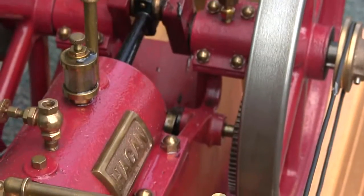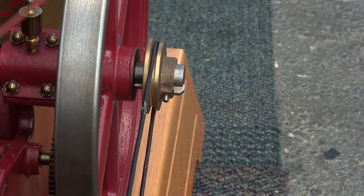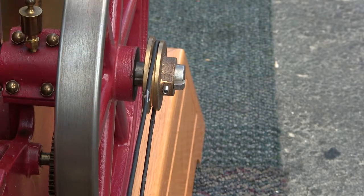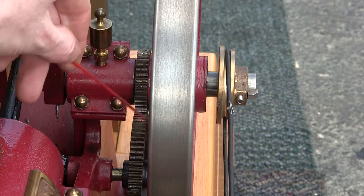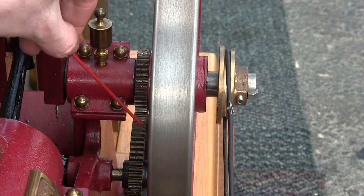Right here you can see where the pulley is mounted back on the crankshaft. There's a set screw right here that holds the pulley to the gib key so you can adjust it out to where you need it. If the flywheel is off, you'd have to slide the flywheel on to where the gear lines up. Don't shove it in so far that it hits the edge of the bearing cap — if it hits the bearing cap it's going to bind and it's not going to run well. You want it in here so this gear won't ride out and misalign with the cam gear.